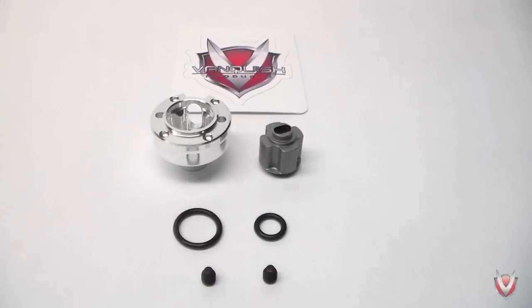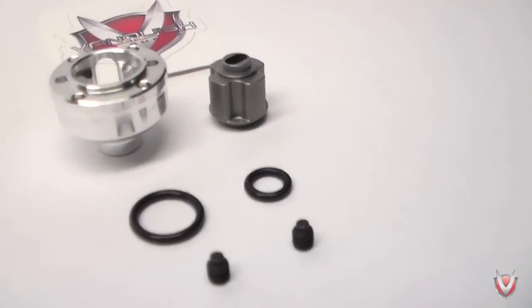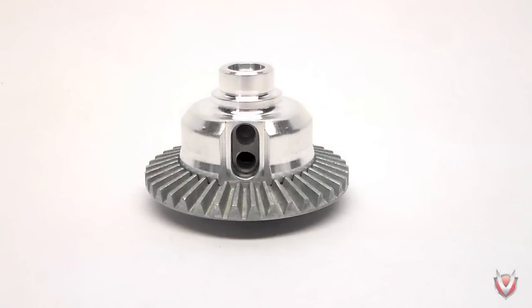It features a floating inner locker to absorb collinear movement that will help address bearing life issues that plague rigid no-slop lockers. It also allows the locker to stay centered with the axle shaft bearings. This will prevent drag caused by uneven pressure exerted by most traditional clamping lockers.